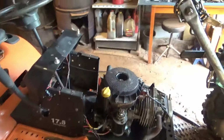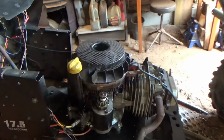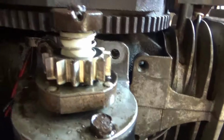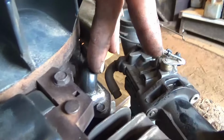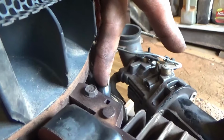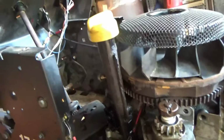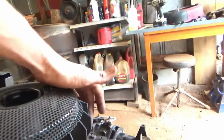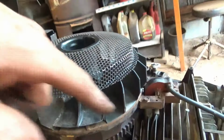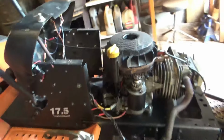So I'm going to put the cover back on this engine just before I pull it, just because I want it to be with it and cover everything up, keep everything protected. But I wanted to let y'all see, we were working with one starter bolt. The reason it was gushing oil is because this was not sealed properly, and that is actually the crankcase vent. So it was spewing out of there when I had a catch can that was over here hooked to that hose for it to shoot into the catch can and I could just put it back into the system. But instead it was coming out here, our fans turned this way, and in turn it was slinging the oil on this side. Makes enough sense to me.